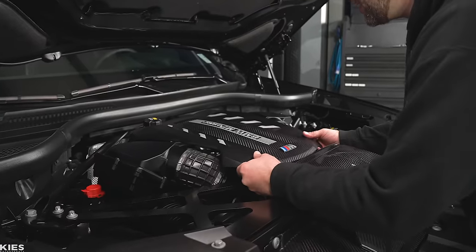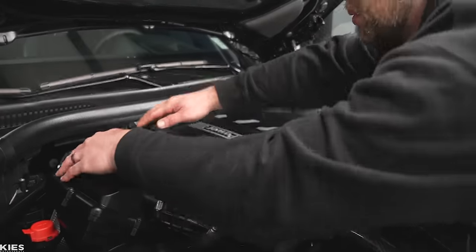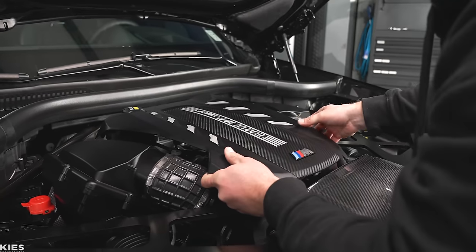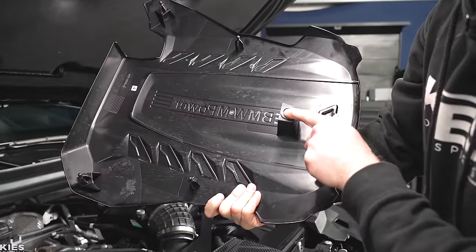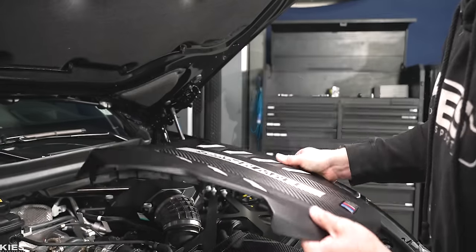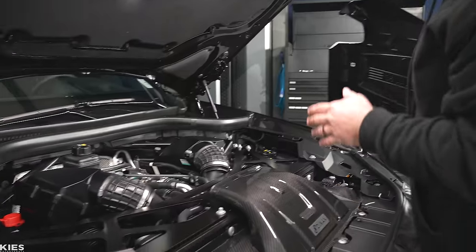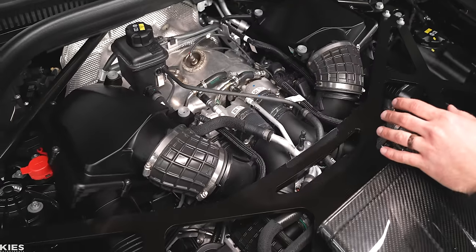Next, we can release the engine cover. Just carefully pull up — make sure you're pulling up on all corners, don't just pull up from the front. If you look, you will see that there are five locations where this is mounted: one here, two here, and then two in the back. That's why I always go around — if you just take it from the front, lift it up, and rip it, you're going to break it. You can see why BMW uses engine covers because that looks a little bit funky, but it is super cool that you can see the turbos right there.